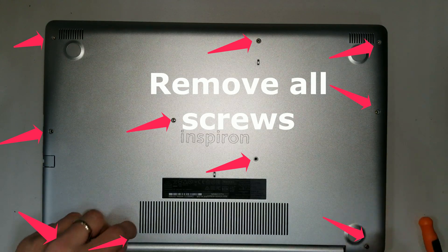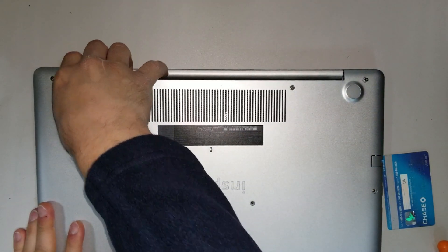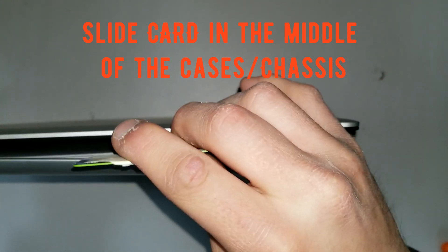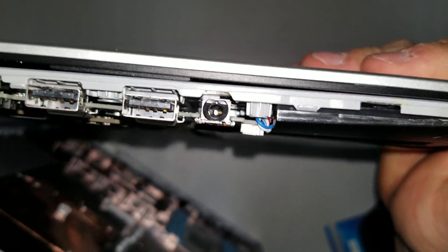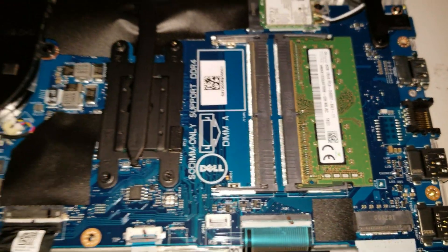In this video we're going to talk about the Dell Inspiron 2019. The first thing you need to do is remove all the screws around the bottom cover and start lifting it from the top cover to separate them. The best tool to use would be a plastic card, guitar pick, or triangle plastic tool to slide along and separate the chassis. Grab both panels softly and gently to separate them.